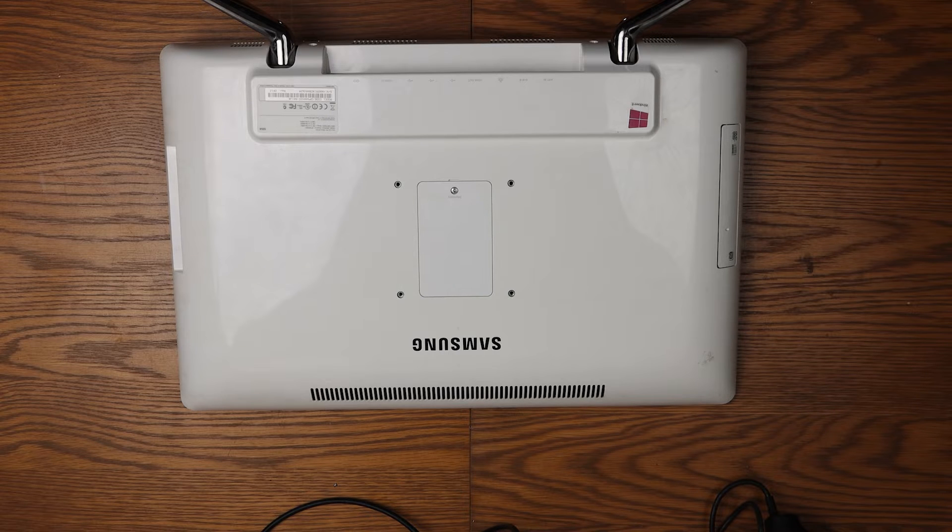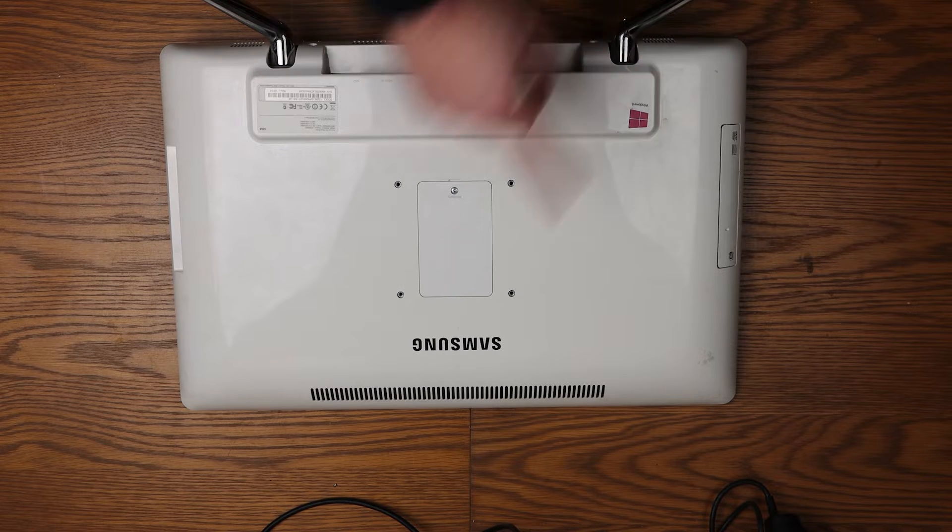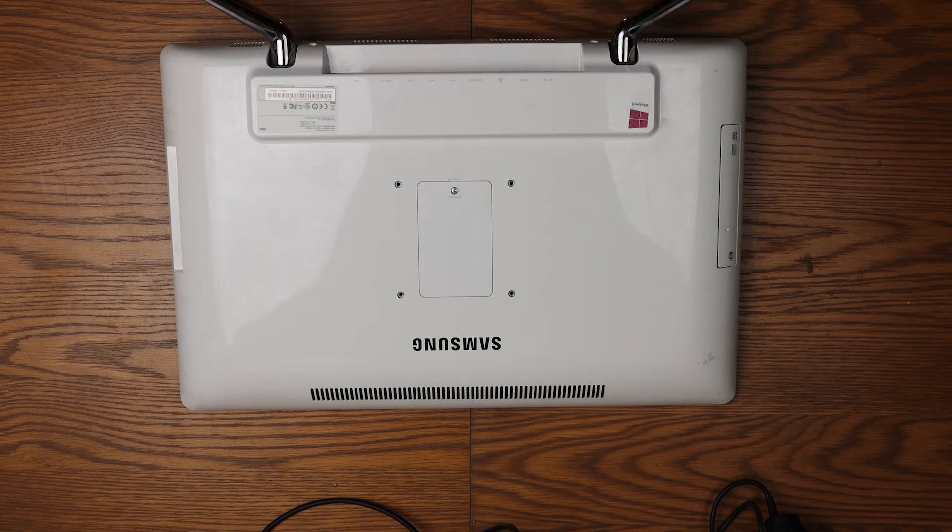So today the purpose of this video is just really to demo what the upgrade of a hard drive looks like on this unit. It's very straightforward — it shouldn't take any more than about five or six minutes to do. We start by taking the feet off, undoing the back, getting the CD drive out. There are a few other screws and then the whole back drops away.